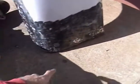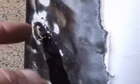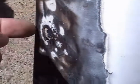Got a grinder, some hammers, and some other junk. You remember in the last episode — this edge is all broken and torn. Here's a tear, there's a big hole — see my finger behind it? That's where these guys beat the dent in, filled the hole, and put bondo over it. So I beat the dent back out, it pushed this out, grinded it off, and now I'm gonna weld the holes closed. There's a nasty one there.